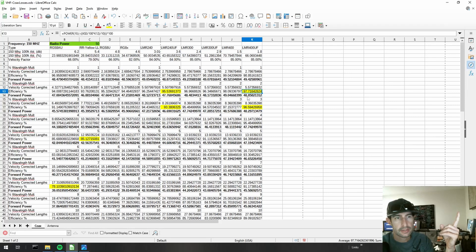So those are the two key things: shorten your coax and route it better, and get a higher-quality coax. In the KRX, to go from a 12-foot coax down to five and a half feet, I'm moving the antenna to the center of the roof — closer to the front of the car — so instead of running the coax to the rear of the car and then forward again, we just run it forward and down. If that doesn't quite work out I'll jump up to just over eight feet, which still loses less than two watts — a drastic improvement.